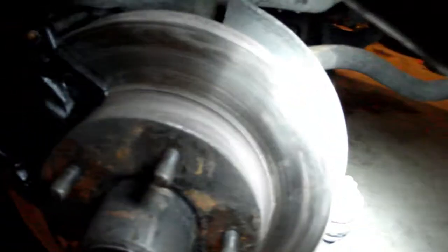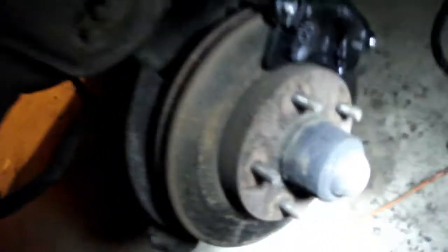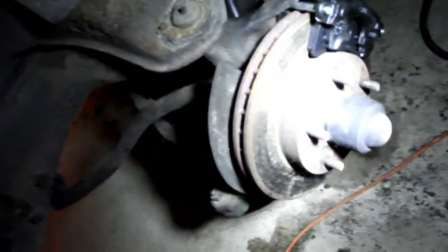Make sure you see right there — it still needs wiped down, it's got a fair amount of grime. You've got to get all that stuff off because it'll mess up your brake pads. You want them cleaned. And that little bit of rust right there — that's not going to hurt anything. As soon as I hit the brakes once or twice, it's going to clean that right up. But that's how the brakes are supposed to be done properly.